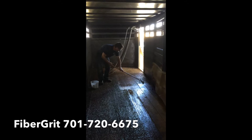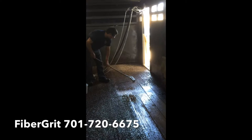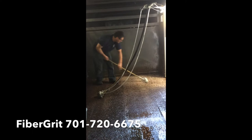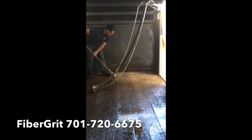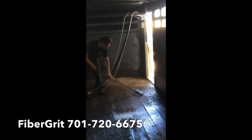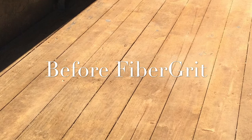Now I've got my fiberglass base. I'm going to take this big roller that we use for rolling all the tanks and press the grit in — it's heavy, so we're pressing it into the fiberglass and rolling that out to get a nice stick. Then I'm going to give it one shot of resin over top just to hold it all into place. Get a nice contour with this — works on used floors and brand new trailers alike.